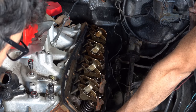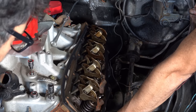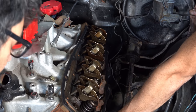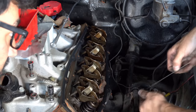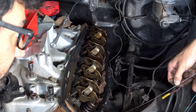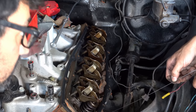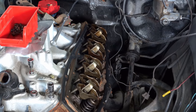Ready? So that should be intake down, right? Yep. And then it's gonna close, and now you should be feeling compression. Yep. All right, we're gonna put the rod back in. Watch it come up. Up there? That's it. So that means the rotor's dialed in right too.